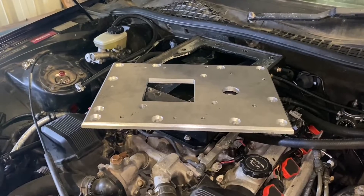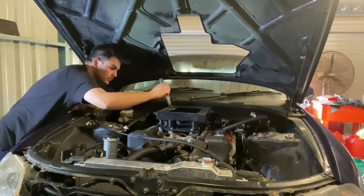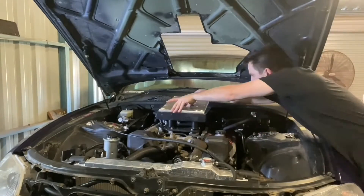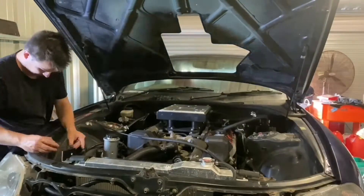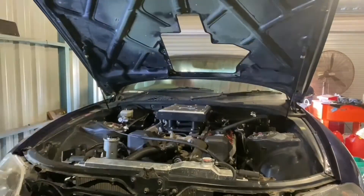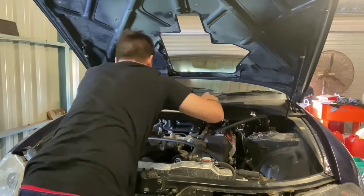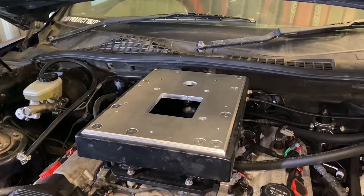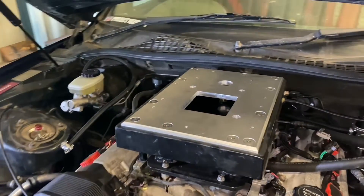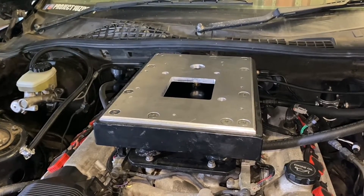There's the finished top plate. Now it's time to put some jointing compound back onto that intake gasket and torque it all down. That's all nicely torqued up now — went all to plan and looks pretty nice. The previous gasket on the supercharger tore up, so we're obviously going to have to make a new one before we can install the intercooler core.